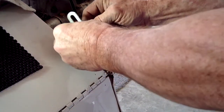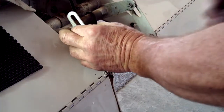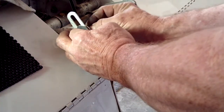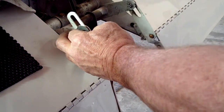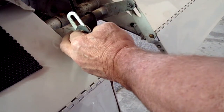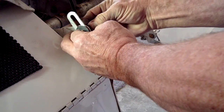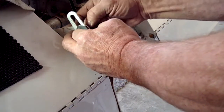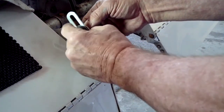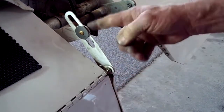Now we're all the way seated, so you can see when we put pressure, this washer still spins. Now all we have to do is add the proper stack to the outside so that our castle nut spins up, and we'll need a thin one in there too. And so now we have it reassembled, it spins and it will travel, and all we need to do is put the cotter pin in.